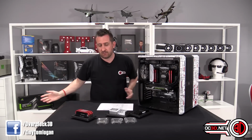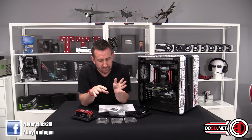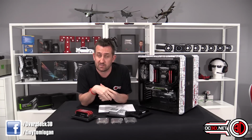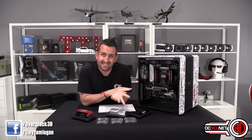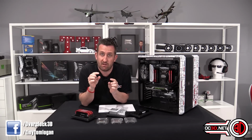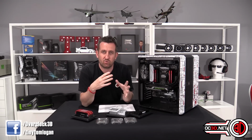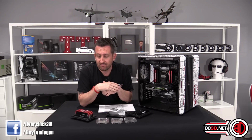Why all this chat about memory though, Tom? Well, something that I have noticed, and it's not just with the Asus kit, because this isn't the first of the new X99 boards that I've worked with, is that they are still clamping down on the BIOS, which is why I mentioned earlier that you're going to need to stay on top of your BIOS if you're going to be using this stuff. The BIOS that we have with this starts with a 0, which essentially means it's pre-release. And the problem with pre-release, and this is the first time I've come across this, is that the memory QVL isn't that great yet. It's all down to memory timings and sub-timings and cache multipliers, and it all gets very complicated. But essentially, best way I can put it is things are a little bit picky with memory at the moment.